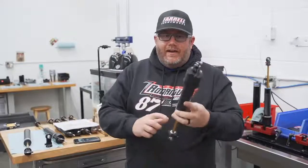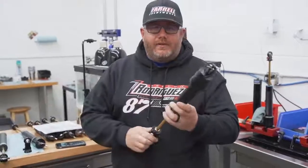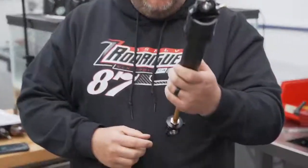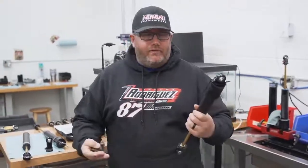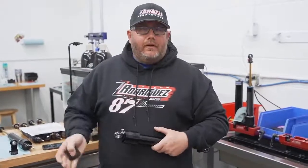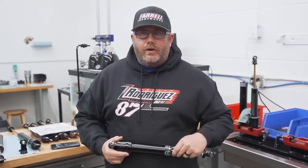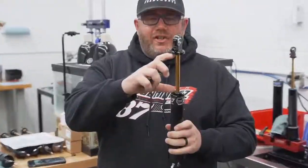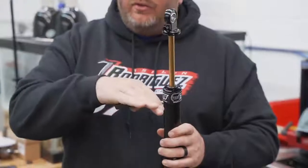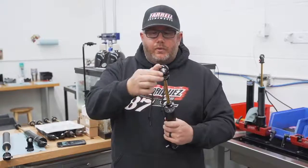If it's 5 inches of shaft showing and you're only traveling 2 inches, we're not bottoming it out — that's okay to have a little more extension. But we want to make sure we don't run into an issue where we're either bottoming the shock out or topping it out often. On the left front of a wing sprint car, if you have a 7-inch shock, we don't necessarily want three and a half inches of shaft showing. We're going to determine how much shaft we want showing based on track conditions, as that's a tuning tool for stopping left front shock travel. But like the right rear, we'd want to be near the center.